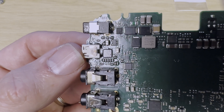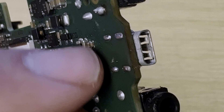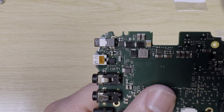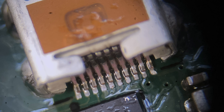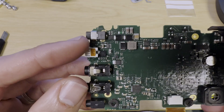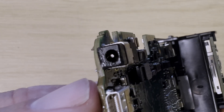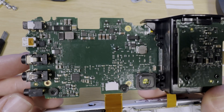As mentioned before, it's very tiny soldering to mount this. You have four points of contact for the body to solder onto the board to anchor it, but that's the least of your worries. The real issue is these micro little legs here. To remove the connector you have to get things awfully hot, so be really careful about the plastic components around it. You can see the connector for the power thing got a bit hot and slightly melted, but not enough to be a problem. That's as far as we're going for the disassembly.